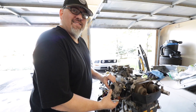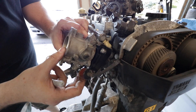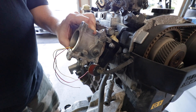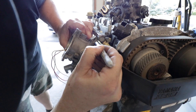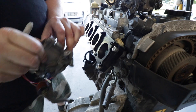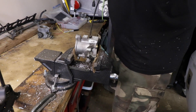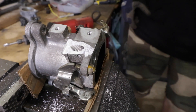It doesn't fit — make it fit Moose! The problem is when you try to mount it, the fuel rail bangs up against this mounting boss. We're going to clearance this a bit so it actually bolts up, because we don't need that boss anymore — that's 4AG stuff, not relevant here. Get out the sharpie, do some sharpie work, then the die grinder. Look at that — no broken bits and it looks all pretty. Take that, internet.